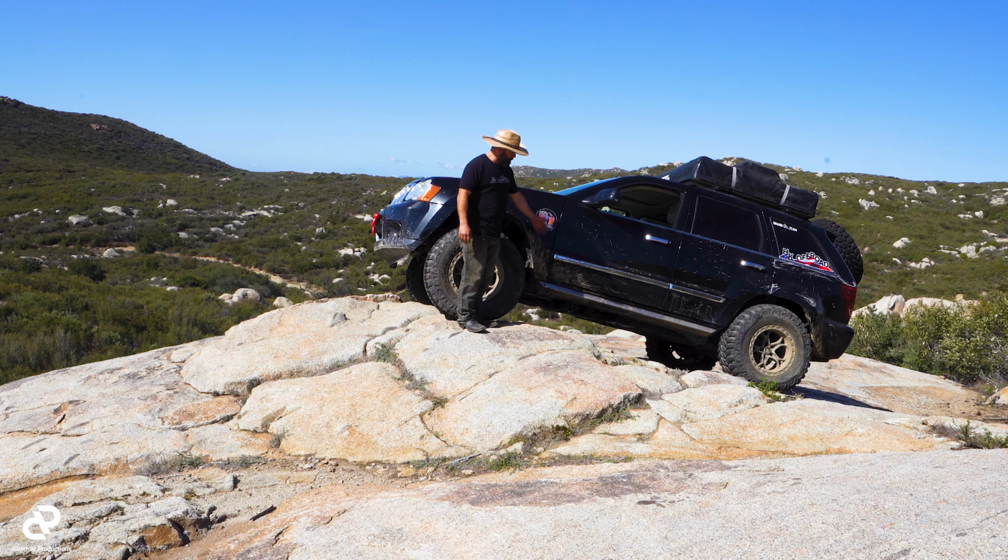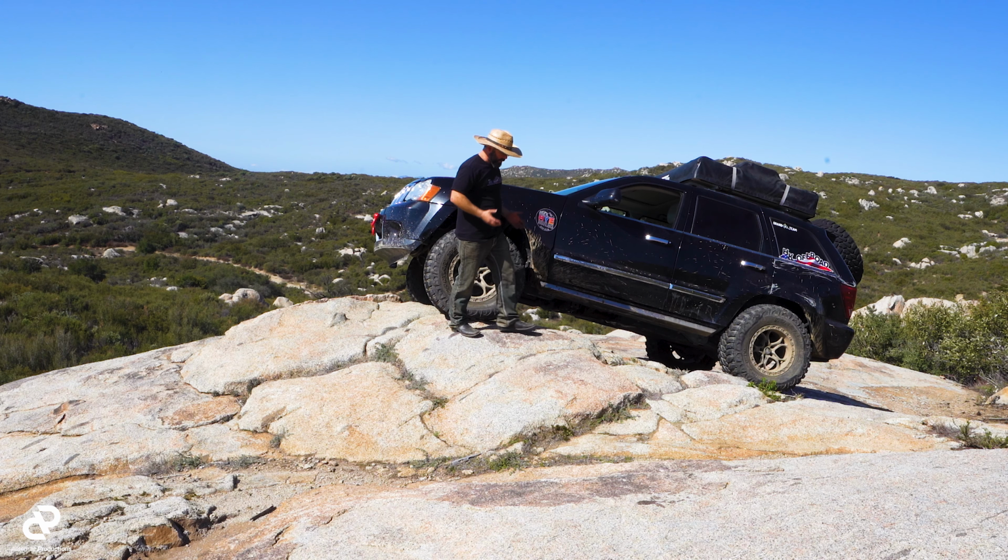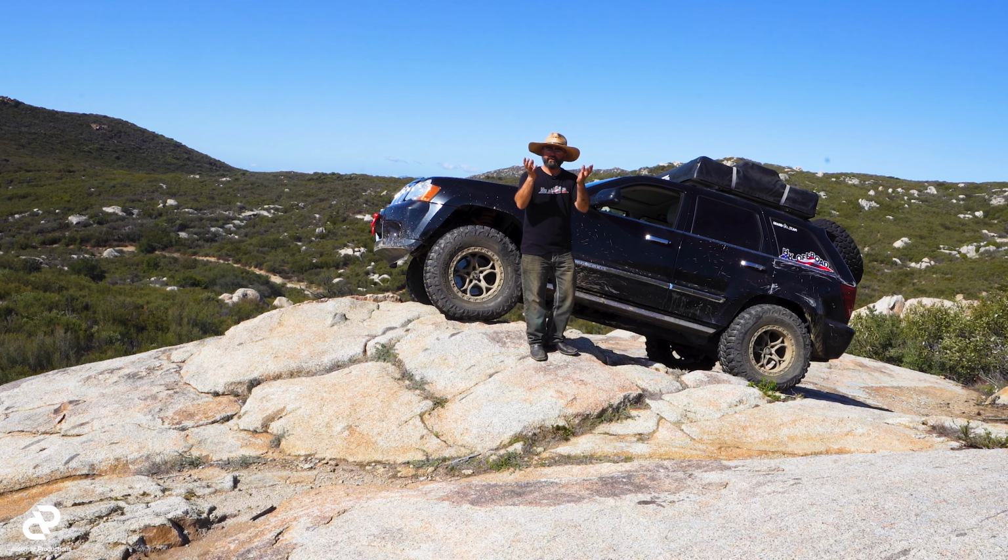rocker panel. So if you should happen to slam down on the slider from the front, the center, or any point on it, you're equalizing the pressure from the impact along that entire rocker panel. And it's got nowhere to move. It can't move. So that's the ultimate mounting point, and it's wedged up in there, okay?